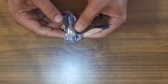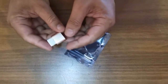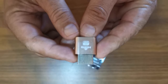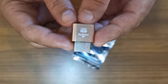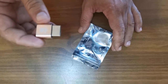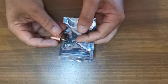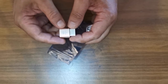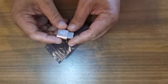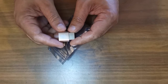Looking at our fourth component, we've got another dummy port and this is an HDMI port — just to simulate a monitor plugged into your graphics card. These you use for the 3060 graphics cards as well. These achieve full resolution when using remote access applications like TeamViewer. The HDMI version supports up to 4K, which is 3840 by 2160 at 60 hertz.